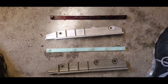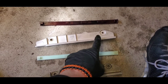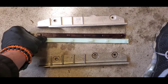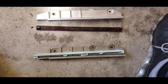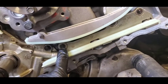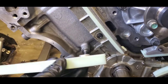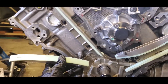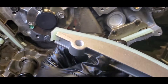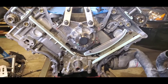Next, put your guides on. I bought a kit on eBay, and I'm using the existing four-valve guide which has two bolt holes. The universal one from the kit doesn't have that bolt hole, but since these guides are exactly the same I'll put the brand new guide on using the Ford OEM guide holes. Tighten all your bolts to 89 inch-pounds. You'll also get two swinging guides — the one with the beveled raised edge goes on the passenger side, and the one without the bevel goes on the driver's side pin.